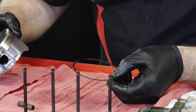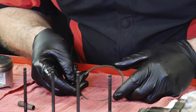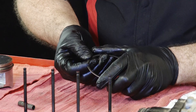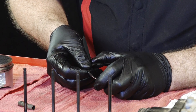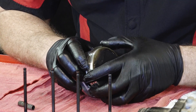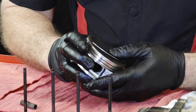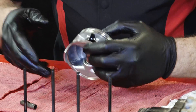What I'm looking for here is any uneven surface that would make it look kind of like an egg. All that looks good. What we're going to do is pull each ring, and then I'll come back to it — I'm actually going to put it inside the cylinder and measure what they call the ring gap. That has to be a certain width, and if it exceeds that, it tells you that either the ring and/or the cylinder is worn. But I'm just not seeing that — the measurements will tell the tale. Into our second ring — same story.